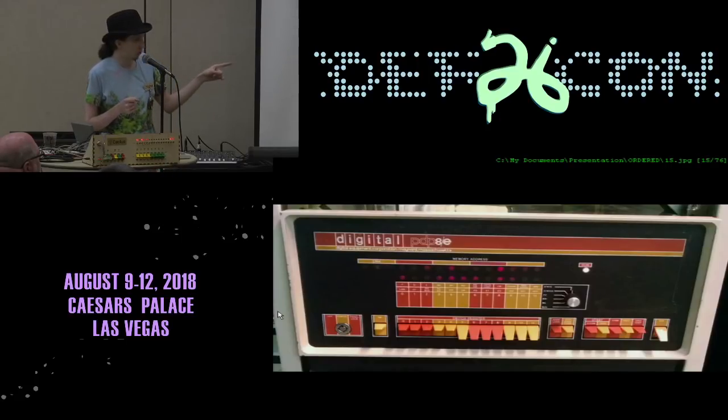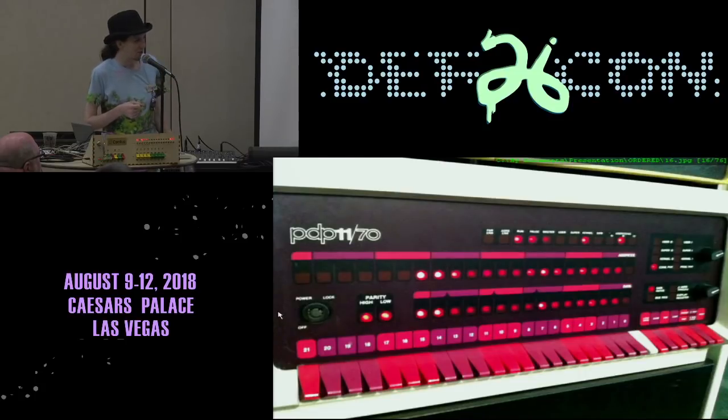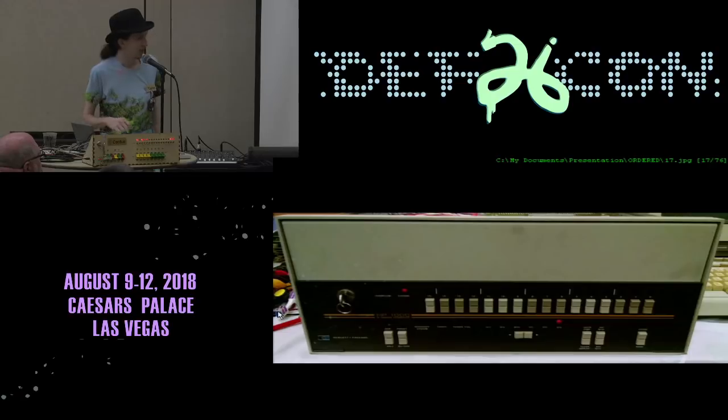Going back a little for front panel comparisons: this is Digital Equipment Corporation's PDP-8E — amazing front panel experience. It assumes you're going to be doing a lot of data entry, so they made it as easy to use as possible. It's a 12-bit minicomputer; this is one of the later revisions from around 1969 or '70. The original is from 1965 and it's huge — about the size of a mini fridge. And then when we get to Unix territory with the PDP-11/70 — we're 16-bit now — but the front panel is still super easy to use because it assumes you'll be bootstrapping from the panel.